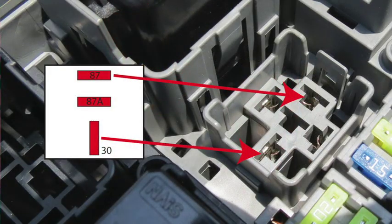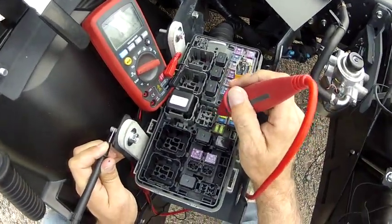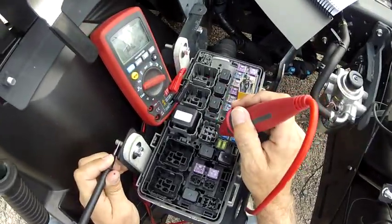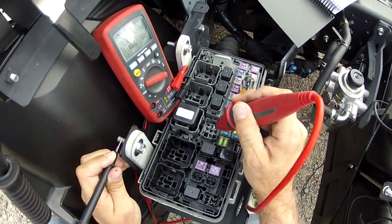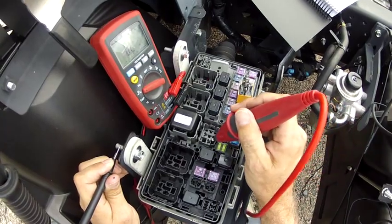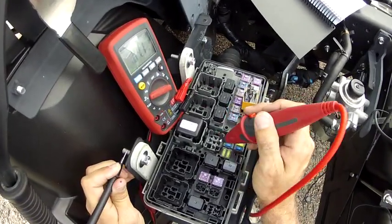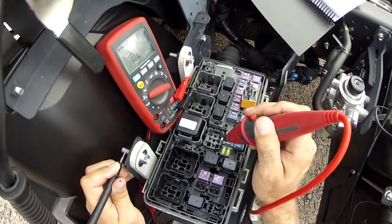You need to learn how to do that, because if you know how a relay works, you understand that every part of the system comes to this 1 square inch. So you have access to the coil and the clutch in this 1 square inch, and you need to know how to do this. So I got voltage here and I got resistance here if I care, and that means that if I jump from here to here, I should make the clutch work.